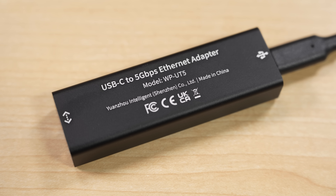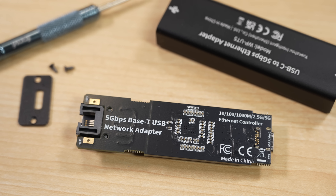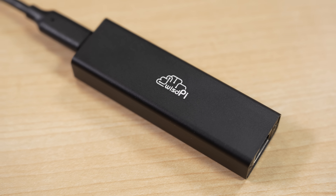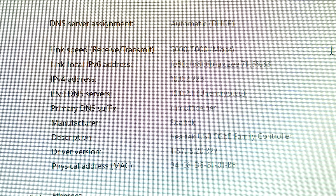That's its own problem — a lot of times I'll buy a jack that says it works with 5 gigs and it ends up not working with 5 gigs or 2.5 gigs. Anyway, something to keep in mind. I think that's a good reason why this WizPi adapter negotiates at 2.5 or 1 gigabit if you don't have 5 gigabits — you can upgrade as you're able to. The best thing about 5 gigs is it usually works over whatever cabling you already have; if you have Cat5e or something like that, you can still get 5 gigabits, which might not work with 10 gigs. This is way smaller than the 10 gig boxes, 5 gigs is still very fast, and it travels anywhere. I highly recommend it — it's a great little box. I hope to see companies like Anker and Belkin start making these, because more is better as long as it's the same price and not burning your hand.